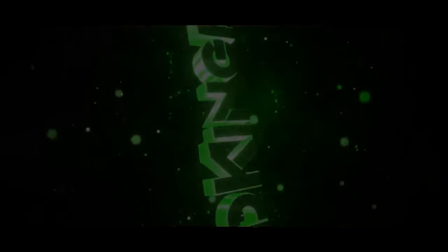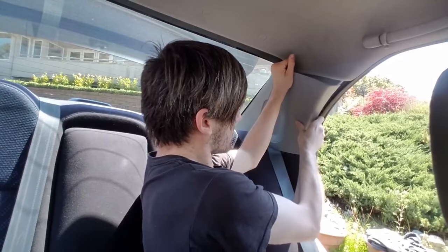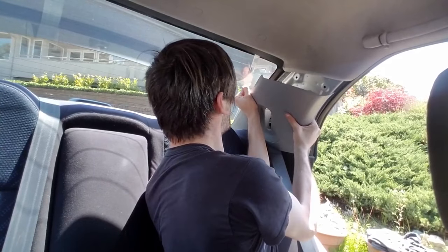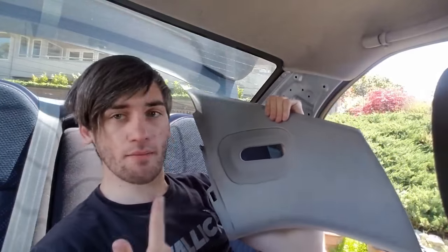So we got that bolt off — what size is that socket? I just kind of felt it out, I didn't really check it. 9/16s. Okay so 9/16s will work. Probably not the 100% accurate one because I know you can use metric on import cars, but basically just get your fingers in here and pull it out gently, because you don't want to break anything. You might have to pull up this piece in there and it just comes right out just like that. I'm going to clean it up and then paint it up. The paint I got is a Krylon Color Master paint and primer — hashtag not sponsored, could be sponsored — but it's actually pretty good stuff, just use it carefully. That's pretty much how you get the C pillar off. These guys are working on the B pillars right now, I'll show you what they got going on.